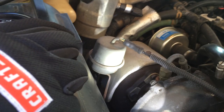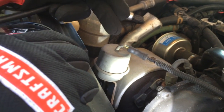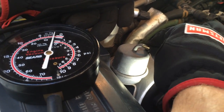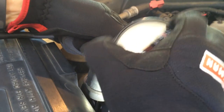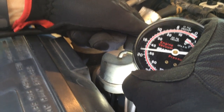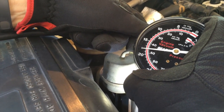We know we have good vacuum coming from the vacuum pump and the primary vacuum line. This next test will help us understand if the problem is in the vacuum actuator or the line from the solenoid to the actuator. Working the hose off the nipple — nice and slow and gentle, you don't want to crack any of this old rubber. We've got the gauge on here, and we're getting 17 inches of mercury, a little bit more — and that's great. Anything more than 15 is good. So we've got a good pump, a good primary line, a good secondary line, and good vacuum coming to the actuator. We know the wastegate solenoid electrical function is fine as well.